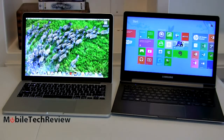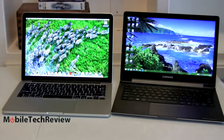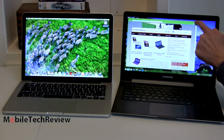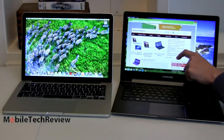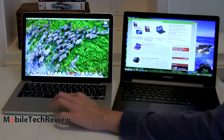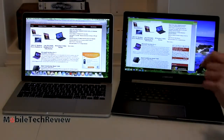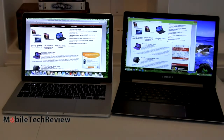In terms of text sharpness, both are excellent. We're running Windows 8.1 here, which has display scaling set to 200%. Icons are a perfectly readable size, web page text is quite readable — ultra, super sharp. You can see the Mac is a little brighter at 320 nits versus 280 nits on the Samsung. Contrast on both is high, about 800:1. Color accuracy is excellent — both covered nearly all of the sRGB color gamut and 75% of Adobe RGB, making both quite suitable for graphics professionals.